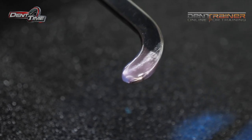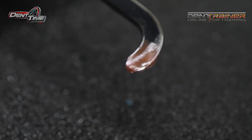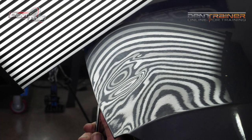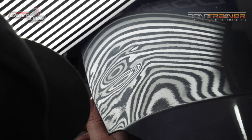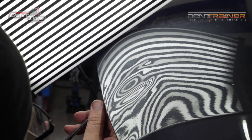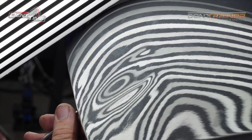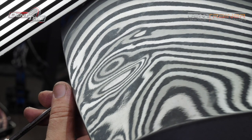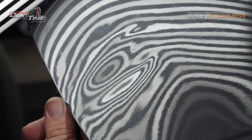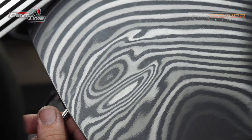It's got a nice little resin on there. John wants to protect that tip. Now what John is doing is probing around the dent — he's trying to feel what it's going to give him. Never ever force your pushing. If you are starting to make high spots in your dent in a similar situation like this, chances are you still have to tap down. Pay attention. Make sure the board is broad enough if you're using fog. Make sure the lines are thin enough if you're using lines. The more detail you can read, the better off you're going to be, and the less mistakes you will make.